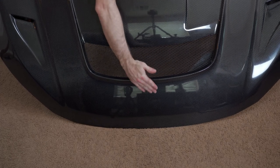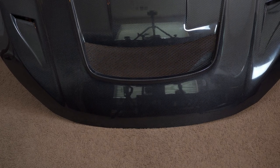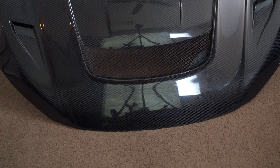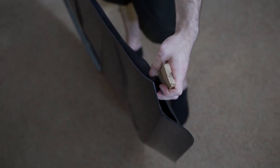We have a giant vent right here over where the turbocharger and inlet pipe sit — as air comes over it, it'll suck all that hot air out, hopefully resulting in lower IAT temperatures. I know Michael Baxia has this hood and still has overheating issues on track, but I'm not tracking this car. There are other cooling mods I'm planning. Whenever you order a carbon fiber hood, inspect the edges carefully — if it's messed up, don't take delivery. I had one lightly scuffed edge that I just covered with a sharpie.